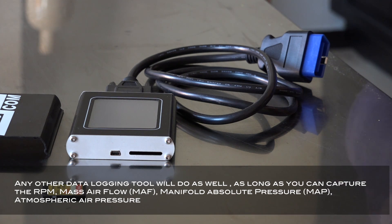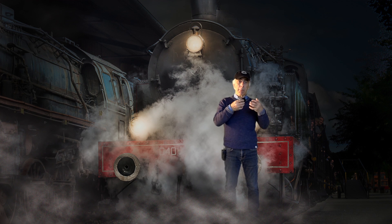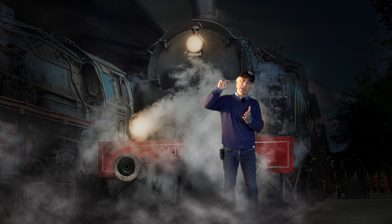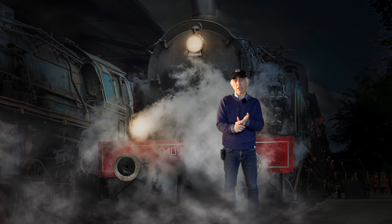The device is low cost, running around 200 to 300 euros depending on the keys and options selected. It's a very important tool for any do-it-yourself Land Rover enthusiast. You'll need to capture RPM, speed, absolute manifold pressure, intake pressure, and temperature while driving. From that data, we'll deduce and plot all operating points on the turbo map for the Garrett 2050. If your points line up in the high efficiency zone, you know your turbo and all sensors are working properly.